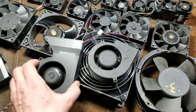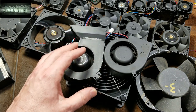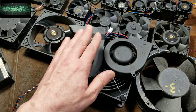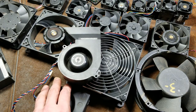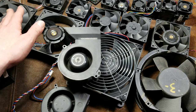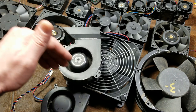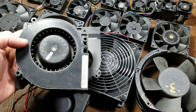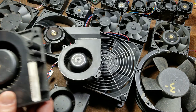We also have various styles of blower fans here. Some are quite high performance. The advantage of a blower fan is for the size of the case — they don't move quite as much air, but they have a lot of pressure differential, especially a lot of vacuum because they are centrifugal type. The frequency of the noise is much lower, so they don't seem quite as loud as many of these other fans because of the way the blades chop and because the air is actually changing direction 90 degrees. They even make some special ones designed to fit a 120 millimeter form factor but just be a squirrel cage fan.